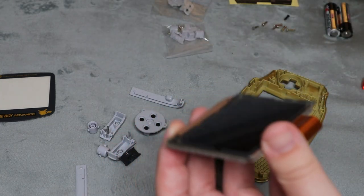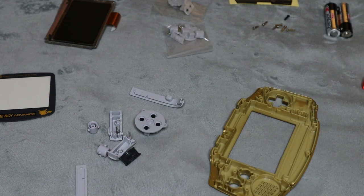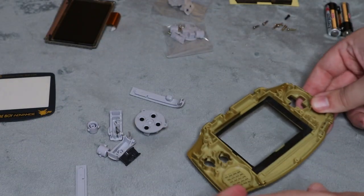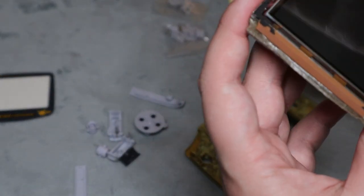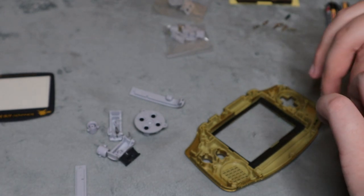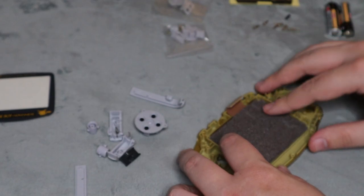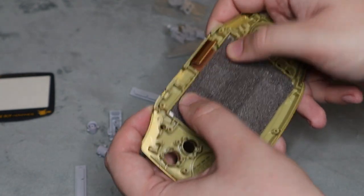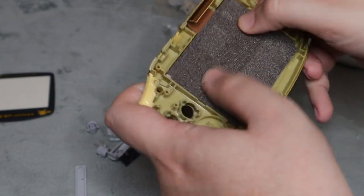So I'm just going to put that onto the new shell here. Flip this over — I took the buttons off to make it easier. And this part here we are going to be reusing. So we now have it removed from the screen. I'm actually going to install it onto the new shell first. Just like that, we do have the gasket on the replacement shell — perfectly square. Now we're going to set this down and put the screen back on it. You're going to want to make sure the screen is clean, which it is. And you're just going to reverse the steps — put it on like this and stick it down. Give it a little bit of pressure, just to make sure it sticks onto the gasket, but don't push too hard.